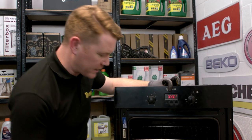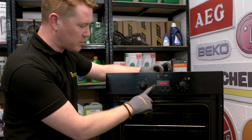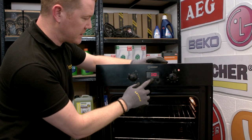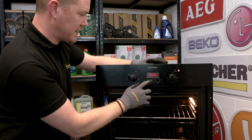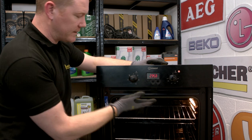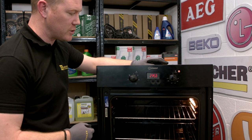With the power back on you can see that the clock is working, but if I try and turn the oven on there is no power. So what I need to do is take the clock out of automatic, set the time, lock it in, and there we have it — power to the oven.